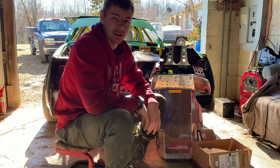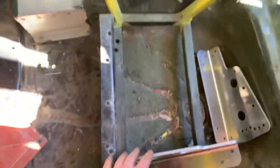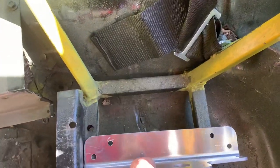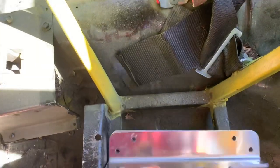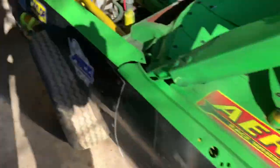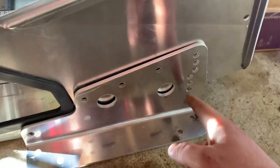We got the seat out. Here's how the brackets are gonna sit. We're gonna take this piece off — it's just tacked on — cut it off, get rid of it, so we just have these bars. Then we're gonna bolt the brackets down. I think that's aluminum so I'm not gonna weld it, just bolt it. It's pretty straightforward. The bracket sits on there, you have your set screw and all these adjustments so you can move it up and down where you want it. We're just gonna cut that off and mount these up.